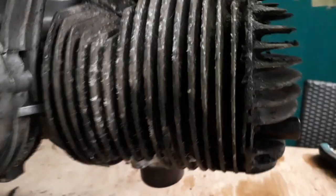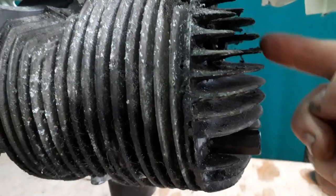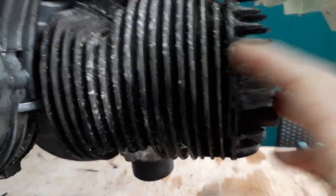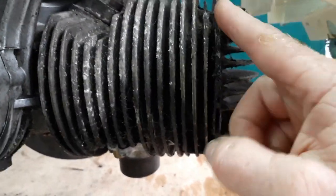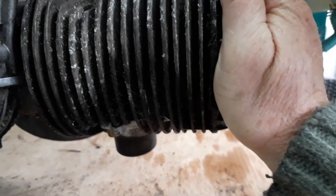That's really overheating your engine — where most of the heat is generated from the top of the fins. Most of the heat comes into these top fins around the centre. The centre part is the hottest part, so you need massive flow over this part of the cylinder head. Unfortunately you don't get it, because when the cylinder head cover is on it comes right up to this edge and it's literally sealed off, enclosing this and not letting any air pass through it. So that's really bad.